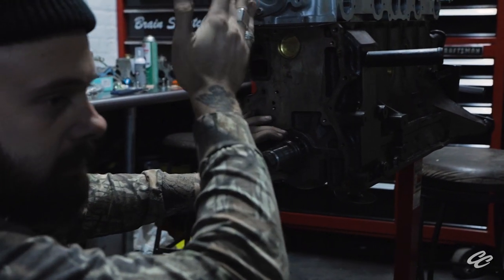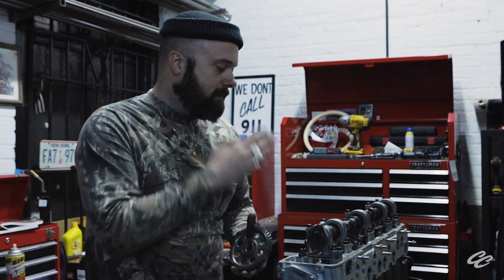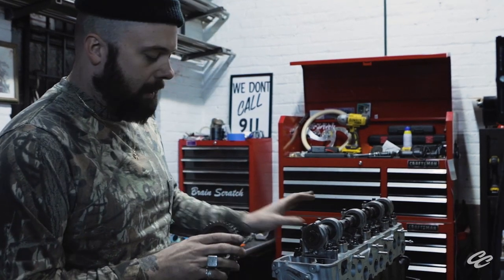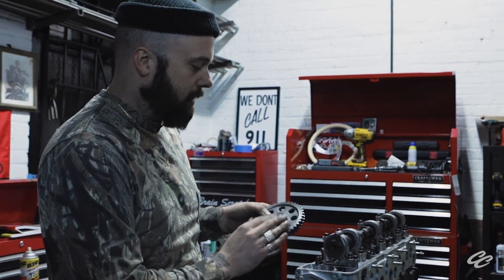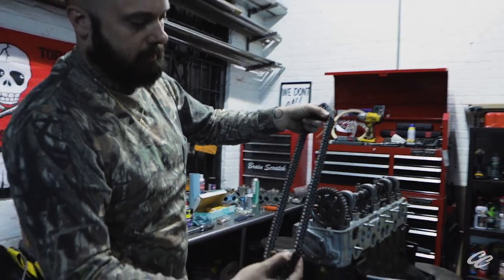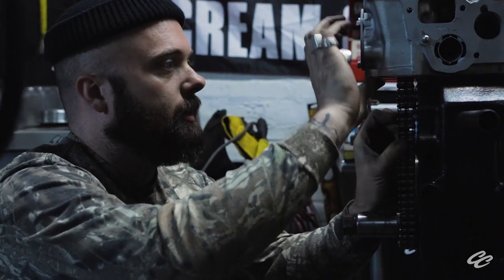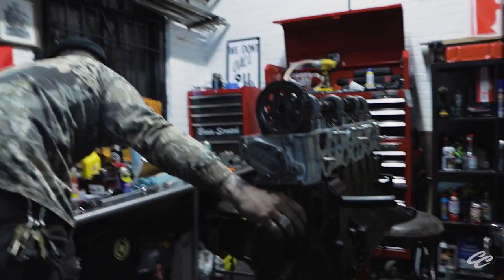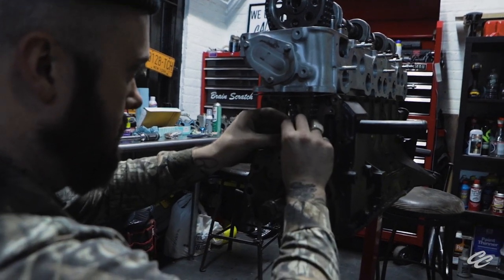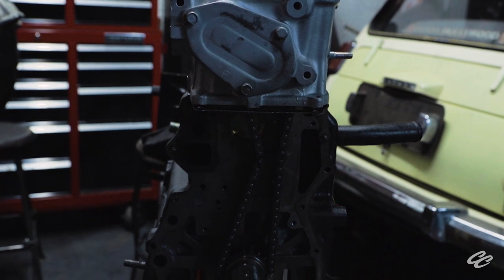You want your timing mark in the correct position — that's going to show you how it lines up with your timing mark at the top when you install the upper cam sprocket. Because everything we're installing is new, the way these things should line up is by the book. Once our dowel is up top, we install our upper timing sprocket and line up number one with the dowel. Then we take out our new timing chain, find our bright links — they should be 42 links apart. The lower bright link lines up with your lower mark on the sprocket, and your upper does the same, lining up with number one. To maintain tension while we install other components, here's a cool little trick: take just a zip tie, that way you don't lose the marks as they're installed. Put a little tension on there and you can cut it off when you install your chain guides, which we're going to do next. That way your chain stays where it needs to be on your sprocket.